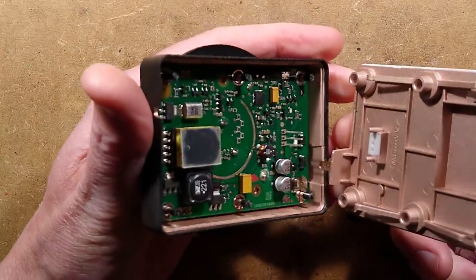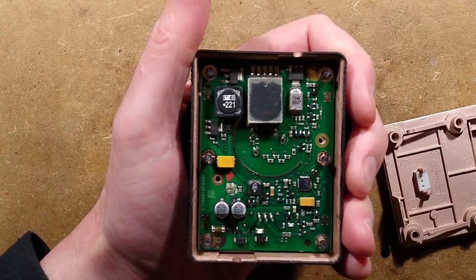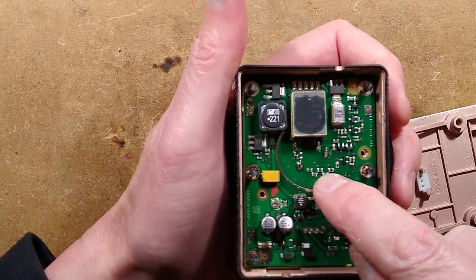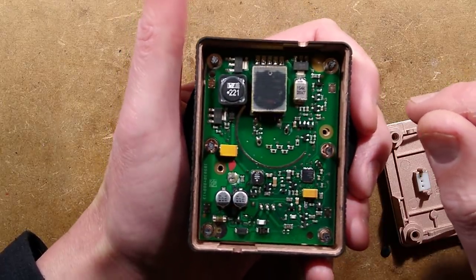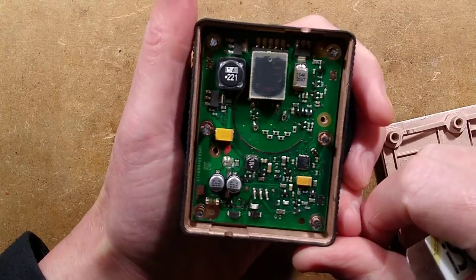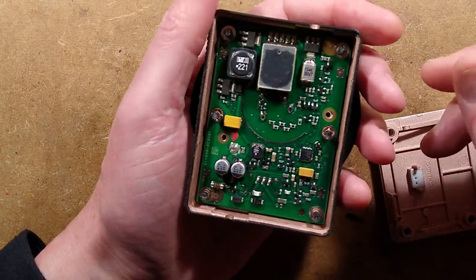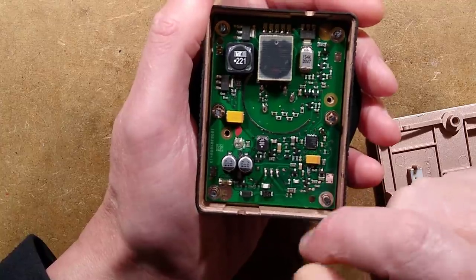Interesting — that is just far too much sophisticated stuff, quite frankly. I'm seeing what looks like a dedicated microcontroller, the high-voltage transformer coming out to the ozone plate, a sensing chain of resistors, a little inductor for suppression, probably a voltage regulator, and possibly the drive transistor. Here are the three pins for controlling this. I'm going to zoom in and take a closer look.